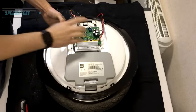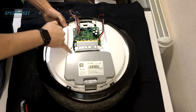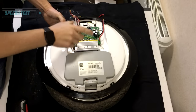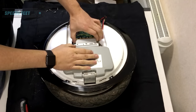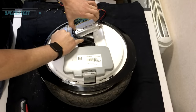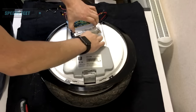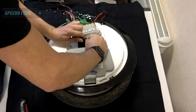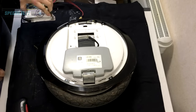You've got the board now that's loose, so you can disconnect this cable. Quick note — you've got a backing plate here, which is a metal plate that runs around here and around like that. Some older versions have a smaller square at the back, but it's the same function. Slowly lift this up and it releases that cable. Now, you've got an arrow on this cable, so when you put it back together again, you need to align those arrows. Slowly pull it apart — it's quite a tight fitting. There you go — and that's the board out.